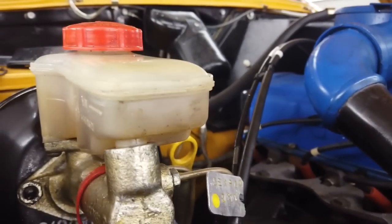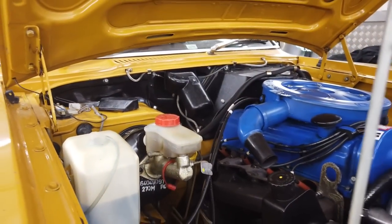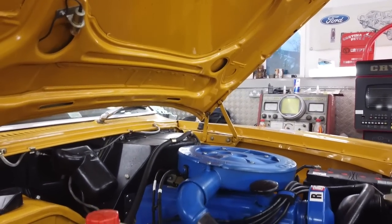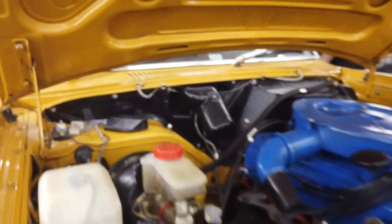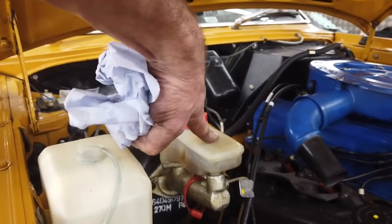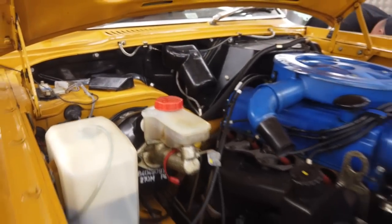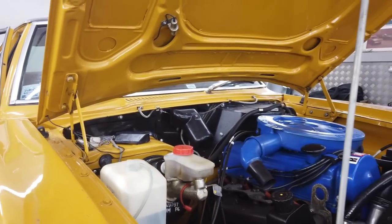Now, I'm hoping I've not done any damage. We're going to have to wash it down with water. There was a jet went over my air cleaner, and it also landed on the wing that side. Nasty, a sting in the tail for today, but it just goes to show nothing always works to plan. I've never seen a fracture, and you would think that it could take 50 PSI. You wouldn't think that would blow. So I think something's over time gone brittle, and the Easy Bleed has exposed the weakness. You saw that shoot out and me panic, and that was a panic, because brake fluid notoriously lifts paint.